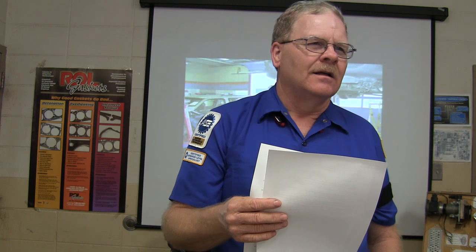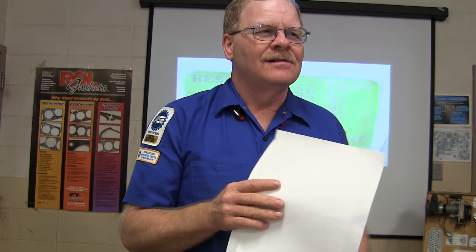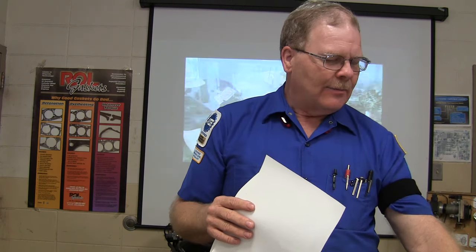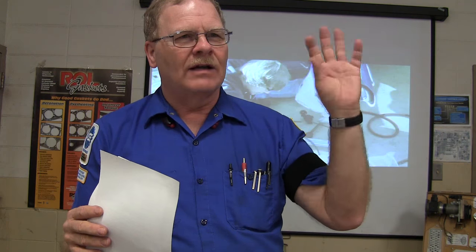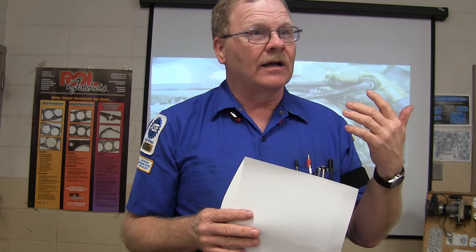You know, I'll read to you where I found it. You ever get out of the swimming pool on a cold day and you're cold? Why? Compressed low pressure gas refrigerant from the evaporator into the high pressure gas. That's why. Why do you get cold when you get out of the swimming pool? If I had some alcohol here and I put it on and pulled my hand out and waved it around, my hand's going to feel cold, right? Why does it feel cold? It's evaporating and it's carrying heat with it when it evaporates.